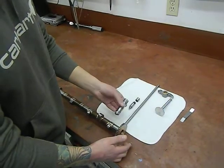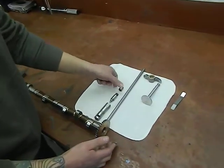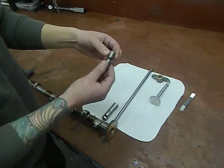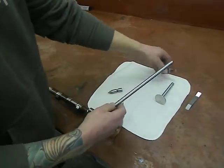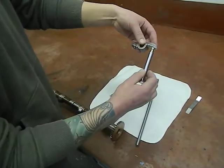We have your roller lifter there, and your hydraulic plunger. On top of that, you're going to have a little socket — it's flat on one side, rounded on the other — and that will fit in like that. You're going to have your pushrod into the socket, and that will essentially go up into your rocker, and that depresses on the valve.